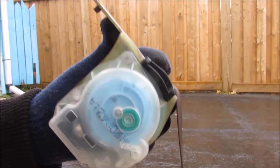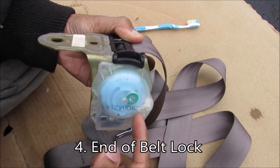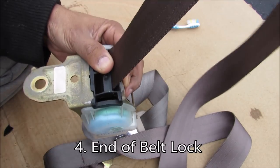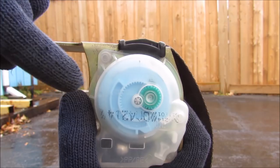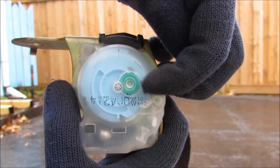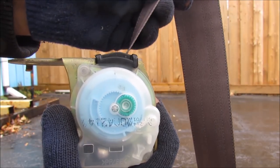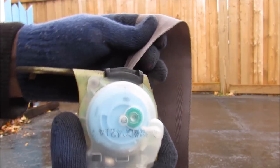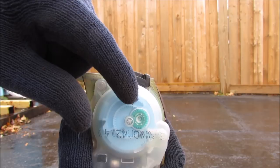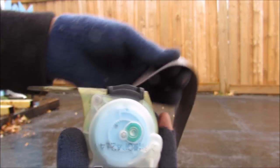What initially allows the seat belt to move in and out is the position of the outside notch on this cam. The final purpose of this mechanism is to provide a complete stop when you pull out the seat belt fully — it locks up when it reaches the end so it doesn't pull out of the reel. We have this light blue cam inside that rotates with the retractor, and an outer cam that engages when the seat belt reaches its maximum position. As I move the seat belt to its maximum position — click — that cam locks the belt from being extracted further. To unlock it, I retract the seat belt until this cam moves all the way back around and clicks back into place, and then the seat belt is free to move.